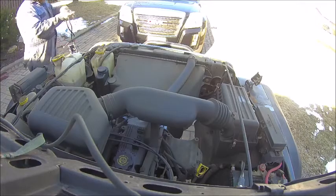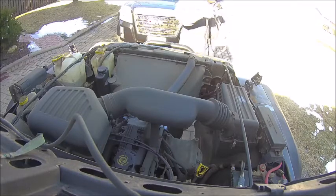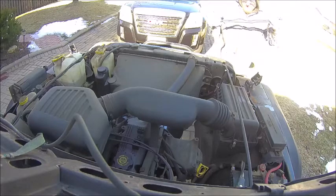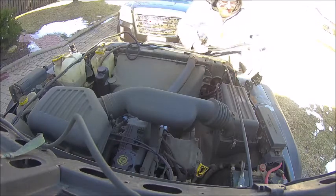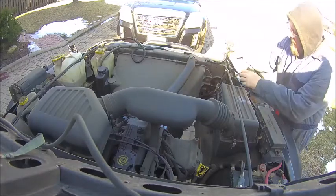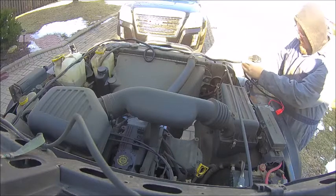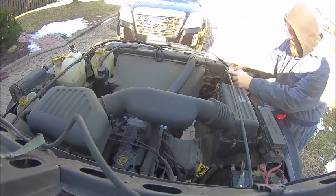Alright, so here we go. I'm getting the wiring harness spread out across the front of the Jeep. Keep in mind, this is the first time I've ever actually looked at the harness outside of the packaging, so I had an idea of what I was going to be doing with it. I knew it had to plug into both headlights and it needed two ground connections. Fortunately, the Jeep has ground connections near both headlights, so that was kind of a win for me.